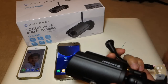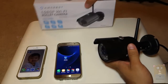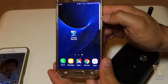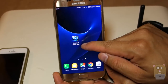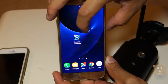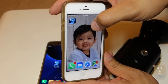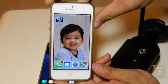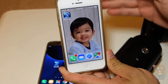First thing I'm going to do is plug in the power because it takes about 20-30 seconds for the unit to boot up. Next, you can take this time to download the app if you don't already have it. It's a free app on both the Google Play Store and the Apple App Store — it's a blue shield icon with a black background. There are two versions: Amcrest View Pro and Amcrest View Lite. It really doesn't matter which one you use, they're both free, so just take your pick. The important thing to note is that the phone you'll be using needs to be on the same Wi-Fi network that you wish to add the camera to.